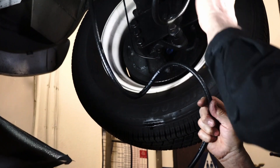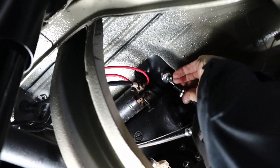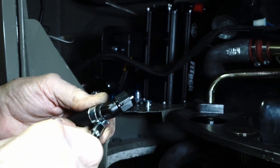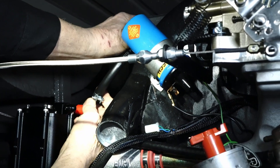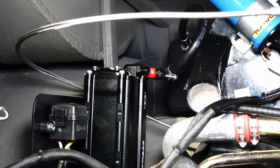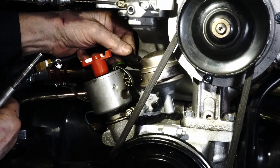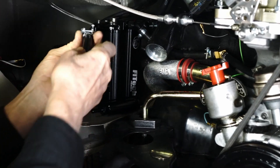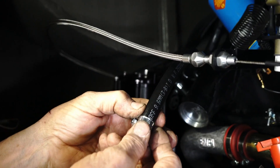Now that we have the force fuel mini installed, it's time to route the fuel lines. We're going to replace the existing fuel line from the gas tank to the mechanical pump, just to ensure that we have the best fuel lines as possible. Next, we're going to hook up the return line. The return line will go between one of the ports in black on the force fuel mini and the other side to the return bung on the gas tank. Now we're going to hook up a fuel line from our mechanical pump up to the force fuel mini to the other available black port. Finally, we're going to hook up our high pressure line from the red port on the force fuel mini up to the FITEC throttle body EFI system.